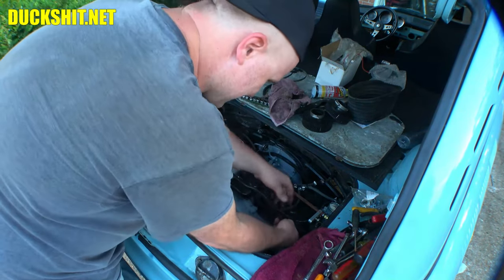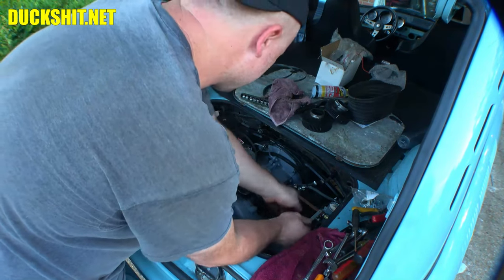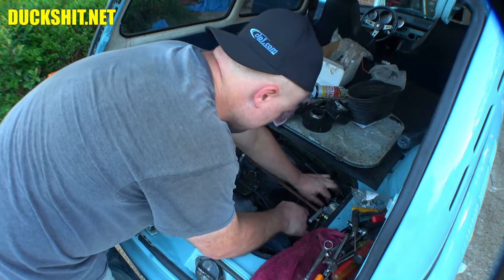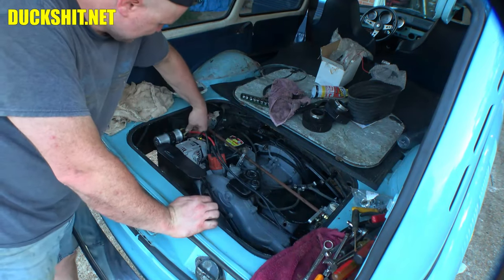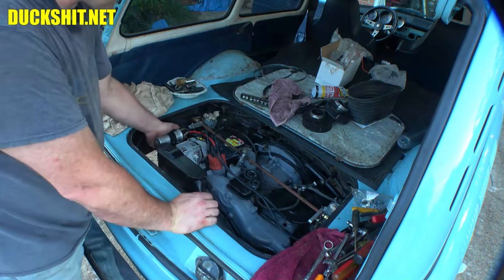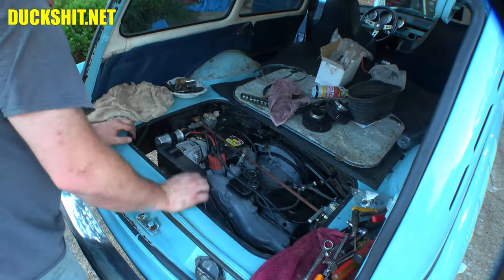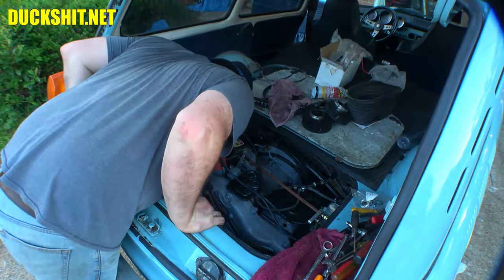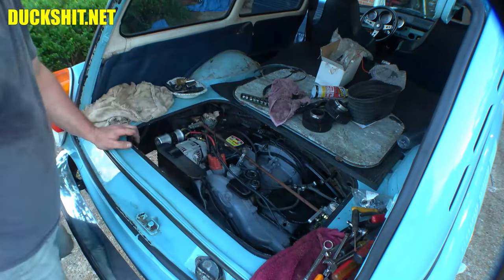This clip is busted — oh well, it's just going to be floating in space. I'm just going to take it off, it's unsightly. And then lastly, almost lastly, we've got the one that goes to the coil — that sucker's a little short, pulled a little tighter than I would have done myself. Maybe I can loosen the coil — the coil actually pivoted just a little bit, that helped. This is really a tight fit in this area because this alternator was not designed to be on this vehicle — it does not belong on there. I'll fight with number three but I'm going to do that off camera.